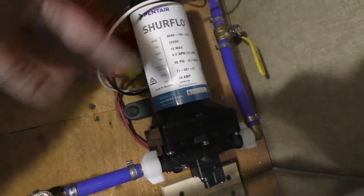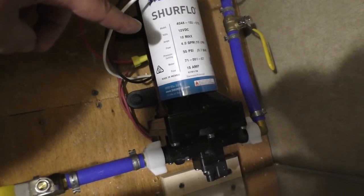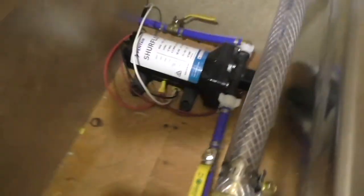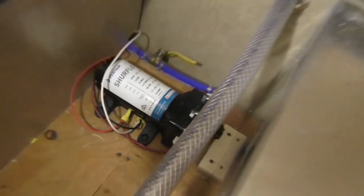In the event that the carpet near the front bunk is wet, the first thing you want to do is get this up and turn on your faucet. The water pump should be running — it'll vibrate, it's not really loud, but you can tell when it's running. You want to look for any sort of leaks, any sources of water around. A lot of times it will leak at the housing, or sometimes it's just a fitting on either side of the pump.